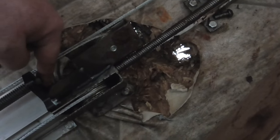They lift the back. And then you see this right here, it's what they call the lift rod, I believe. It's like a spring, kind of. It's flexible. It runs up and then makes a 90 and goes up into the telescoping rods on the corners of the roof. So it looks like what's happened here is this bracket with these two pulleys for the back has ripped out of the floor. You can see those holes go straight through to the ground. It looks like the floor's been pulled back, and I think it actually pulled out and moved back this way until it hit this piece that actually holds the ball screw. I think it's just pulling against that now.